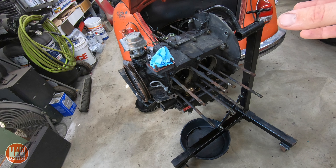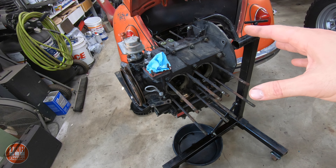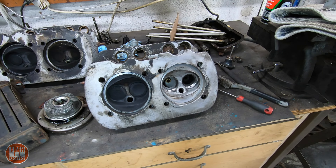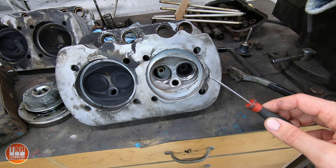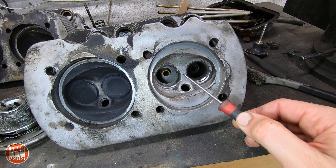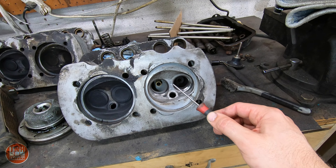The Beetle is still here in the garage making progress. If you haven't already, you should watch the video where I tore down the engine. Basically I pulled the heads off hoping I could get away with just replacing the seals on the push rod tubes. But once I took it apart I discovered some rust and pitting in one cylinder, so I pulled the cylinders and pistons. The plan was to hone all the cylinders and put new rings in, but when I looked online to order the rings I discovered just how cheap it is to replace the pistons entirely. I ended up ordering a set of pistons, rings, and cylinders that are slightly larger — it'll bump it up just a little over 1600cc but should still work fine with the single port heads and the small original carburetor. I ordered that whole piston, ring, and cylinder set for about $150.